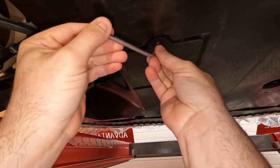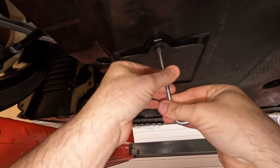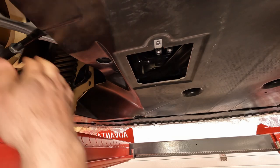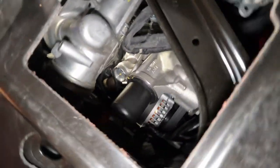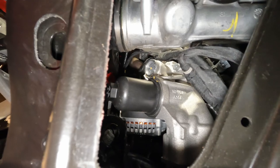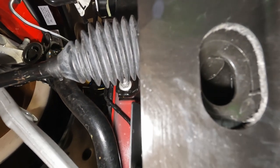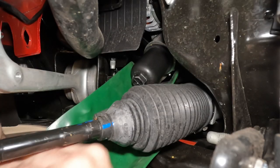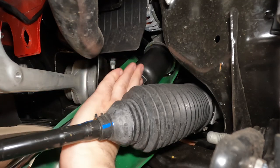The oil filter access door is just inside of the driver's side front wheel. The T30 Torx comes down pretty simply — there might be some rocks or debris under there, that's pretty common. Once you get that out of the way, the oil filter housing is right there. I'm going to use that forma funnel and make a bridge so the oil runs all the way out to the end here and gets either into my small pan or the main upright pan. Let me get that set up.